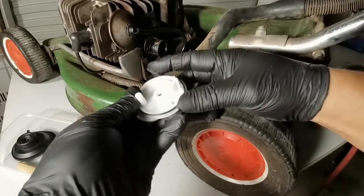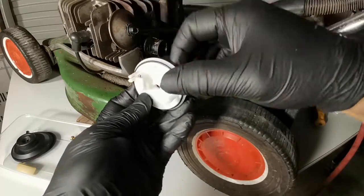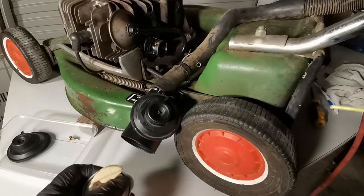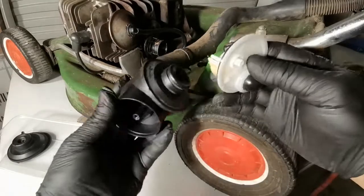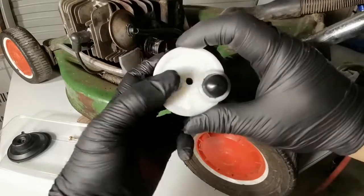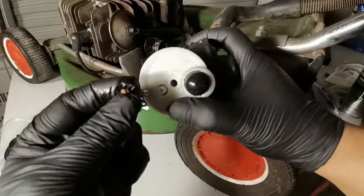Place a little bit of lubricant around the O-ring. When you install it, hold the float so it doesn't fall off. Place it like this and make sure you have the force on the line. Then install the jet.